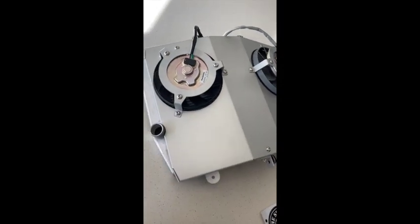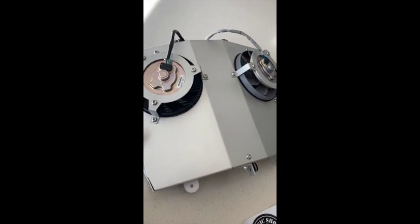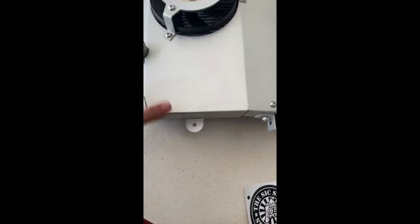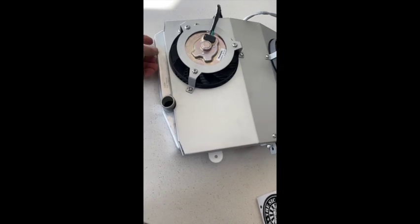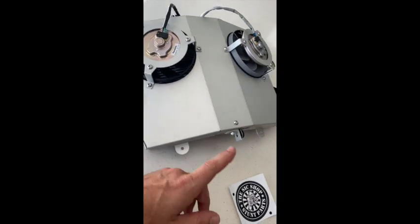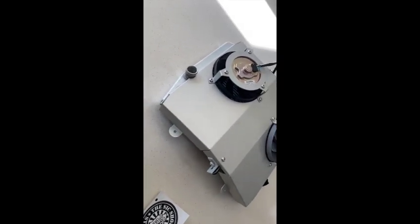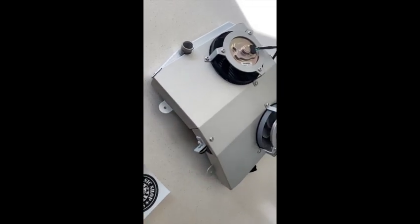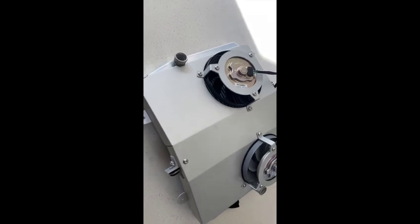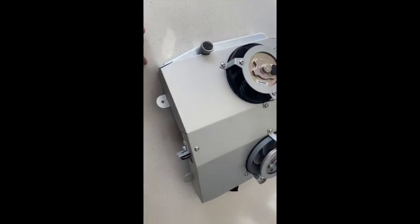I've had the idea for a long time, and this is what I envisioned. It's a really lightweight all-aluminum bolt-on that mounts onto the factory fan mount locations. It has reinforcement tabs for the mounts, keeps the rubbers on the original mounts, and has reinforcement tabs top and bottom. There's a strap that goes across the front for support. It weighs 1.3 pounds without the fans — about two and a half pounds with the fans. Super lightweight, definitely increases strength, and will definitely reduce temperatures.